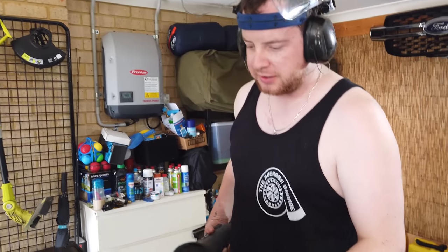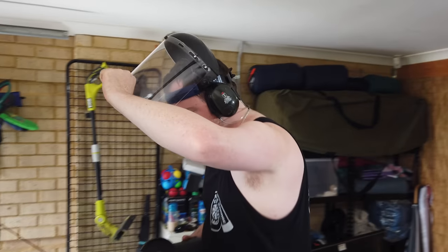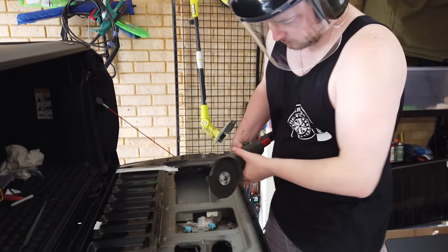So the back we do last because then when it comes time to drilling or breaking the spot welds, we can fold the panel up to see if there's any we missed. So the sheet metal will become malleable at that point. Yeah, gotcha. That's pretty much it. Awesome. We can't change our mind now, can we?